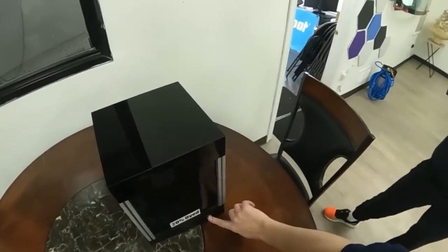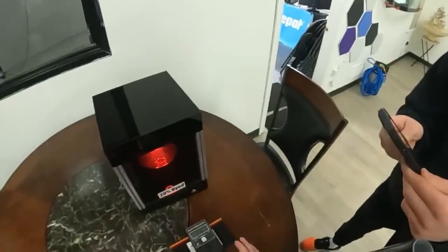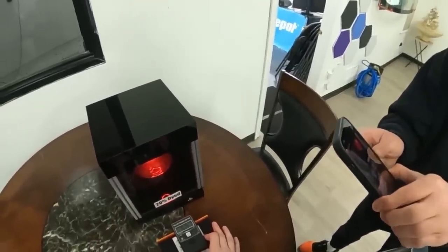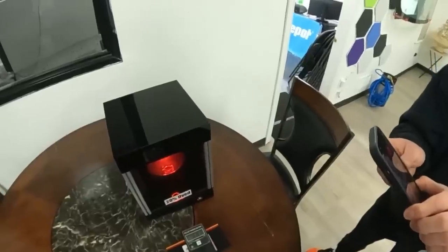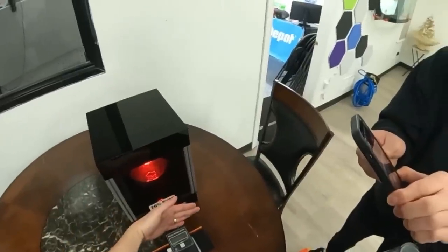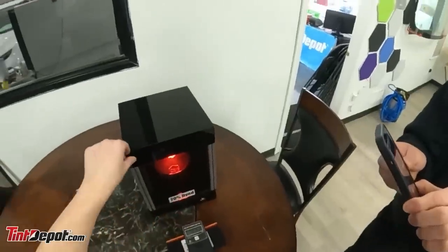So if I turn this bulb on, this is a 250-watt IR heat lamp. I feel a lot of heat coming off of there. I like to place the meter, if I put it close, it gets higher. If I take it farther away, it goes lower. I just like to find a good round number that's easy to do math off of. So 300 usually is good. You can see as soon as I block that, it goes down. That number is telling you how much heat is coming off of here at that distance.